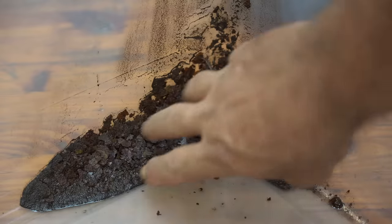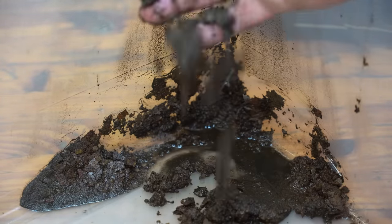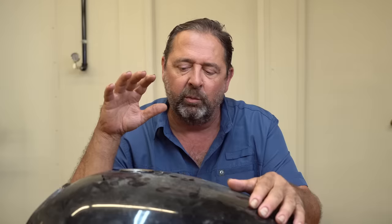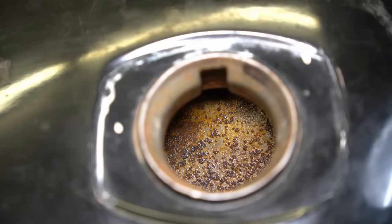Three and a half gallons. I've got the vinegar out of the tank and this is what came out of it - this clump of nasty stuff. There's almost two handfuls of rust that came out of here, big hunks of it that was still stuck to the inside of this tank. You saw when I blasted it out with water, that knocked a lot of the debris out - that sediment sitting at the bottom of the tank. That's what the water got out. The rust still stuck to the side of the tank, the large scales of rust, that's what the vinegar gets out. The vinegar is the workhorse - that is what mainly does the job on this tank. Looking at some before and after pictures, you can see the comparison here. It's night and day, really.